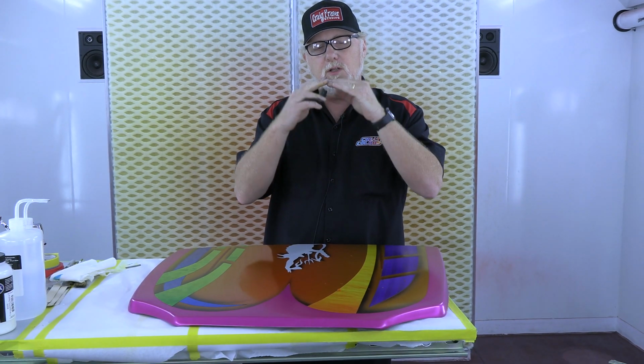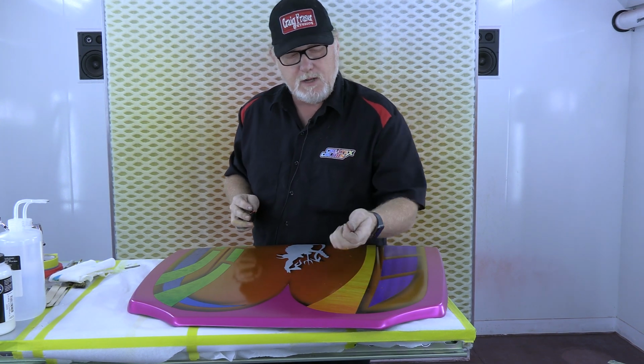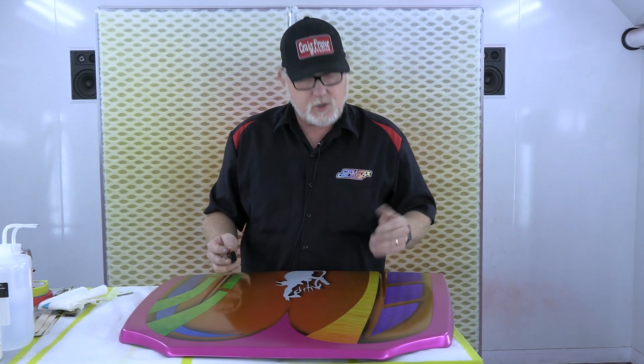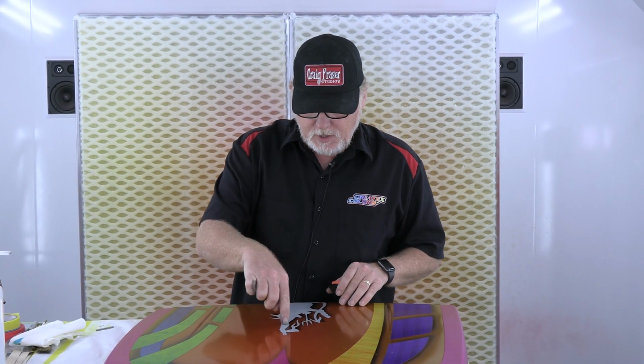The peaking is the problem, where it'll peek through, and then if you're sanding and buffing later on, if there's a peak under that pinstripe edge, all of a sudden it looks like you have two pinstripes with a little color in between, that paint coming through. Major pain in the butt. And right there, it safely removes that edge without nicking, damaging, scuffing or scratching either side. I'm going to finish scraping the rest of this hood, get it all ready, and then I'm going to do a little airbrushing inside the devil, and then it's pinstripe time.